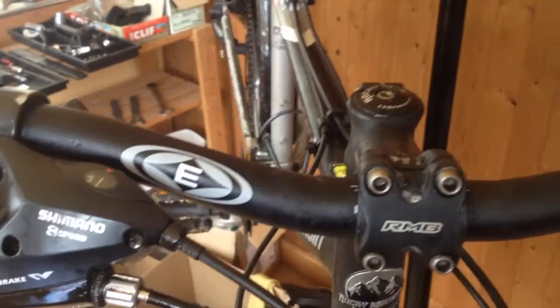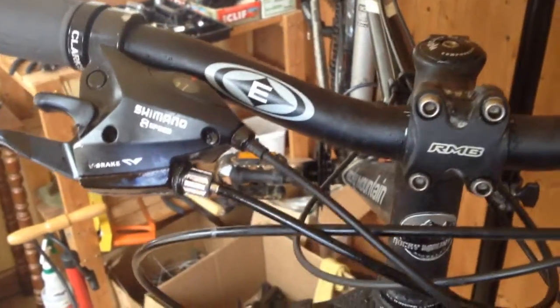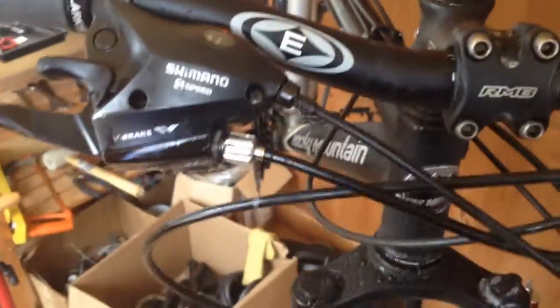And as you can see, the motion is really good. There's no resistance whatsoever. So continuous cable housing is a perfect system for winter bikes. And I don't understand why it isn't just the standard system for all winter bikes. I've gone to look at fat bikes, and even the fat bikes don't have that system for the derailleurs very often. I don't understand why that is.